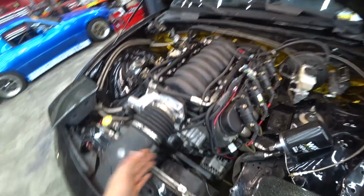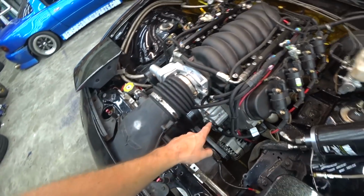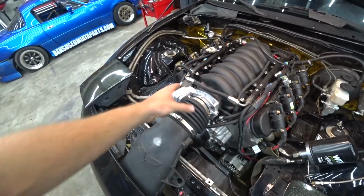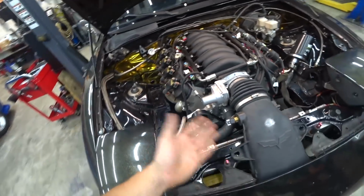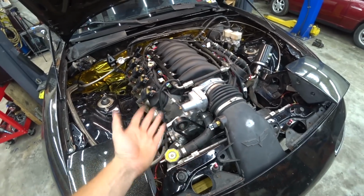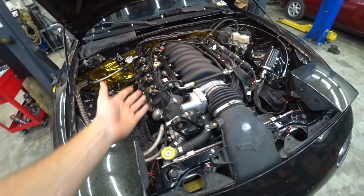The only other thing it could really be, since the rest of the cooling system is the same, is the water pump. I had to put an LS2 water pump on to fit with the throttle body that I didn't end up using. I've heard that these flow less than an F-body pump. I'm not 100% sure. There's only one way to find out. Let's try it.